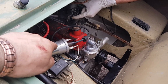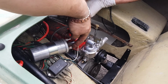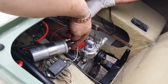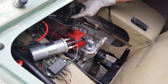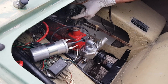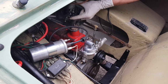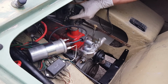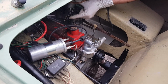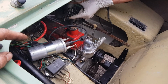There was definitely a fault with this coil. Now Dan's going to get a new coil because there were two terminals on here, this one and this one, that were both actually loose underneath the rivet, so we cleaned them up, tightened the rivets down, or banged them down I should say, and it secured it, but obviously it's not right, so we're going to change that. But that sounds really, really good. That's a restart after about 5 minutes of being off, maybe 10. But it did actually tick over on its own after, didn't it?